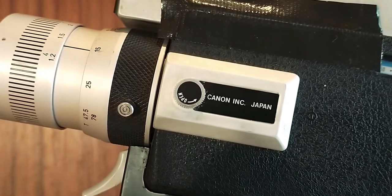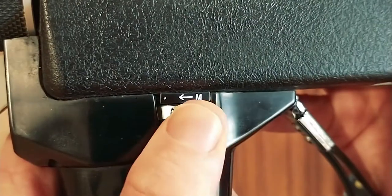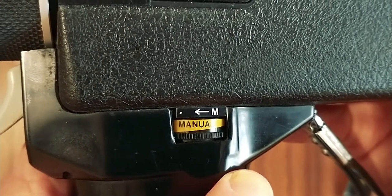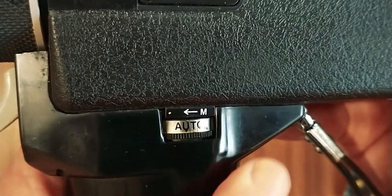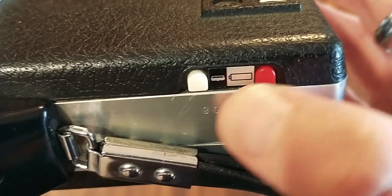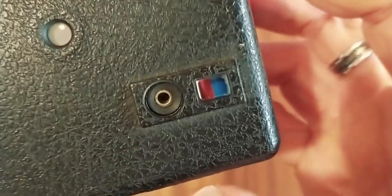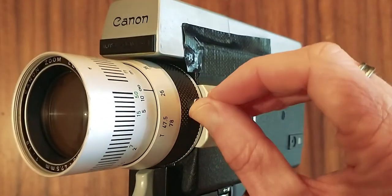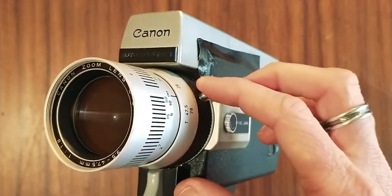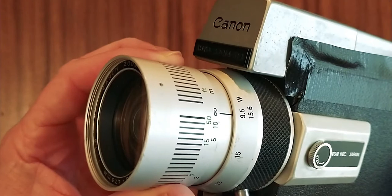This is the sneaky light meter battery hiding place. As mentioned, this type of battery can be hard to find, but I'll show you a hack to overcome this soon. The manual and auto exposure switch — I've never used the manual function; I'm happy to let the auto exposure do its thing, so I keep a piece of tape over the switch, otherwise it's too easy to bump it to manual without knowing. This little window is the battery gauge. Underneath the camera are two little buttons — one white and one red. The white tells you if your light meter battery is working, and the red tells you if your double-A batteries are working. There's also another zoom function on the opposite side of the camera, which would be handy for a fast-paced or crash zoom. And finally, the focus ring — turn it and focus your image as you look through the viewfinder.